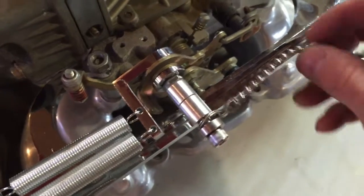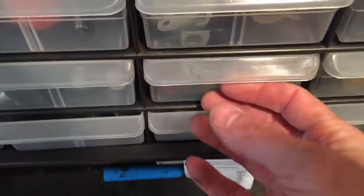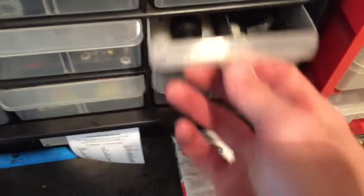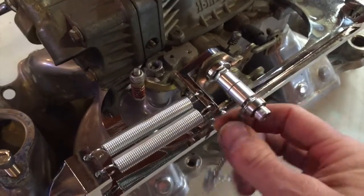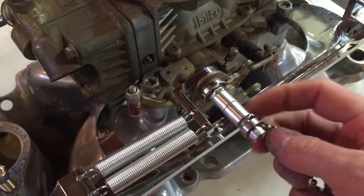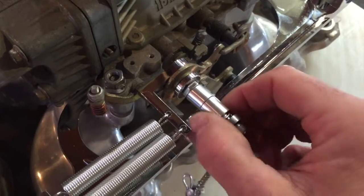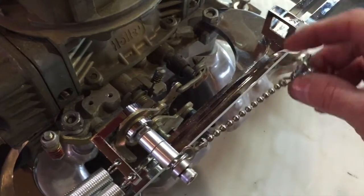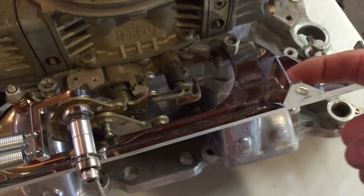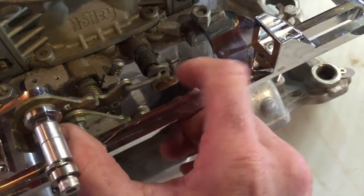Some bushings — and I'll be honest with you — came from a wall mount for a TV. Right here are all stuff mostly from a TV wall mount hardware bag. I kept all those bushings and they've come in handy. There's a total of three bushings on it, then I put a jam nut in there. This piece is threaded on the throttle return spring kit — quarter-20 — and jam nutted. These can stay loose because on your throttle control you want it to be free and not get bound up. My regular throttle cable fits in that square hole like on Chevys, and clips to this part of the throttle body.